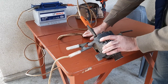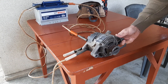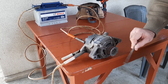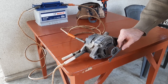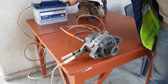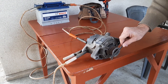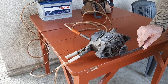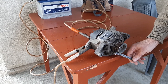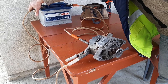I tried to attach a 10 mm wrench to the pulley and you see it sticks to the rotor. Why does it happen? The matter is that alternator diodes are one-way valves which allow current flow only from the alternator to the battery. If a diode fails — even one diode — the battery voltage will flow back into the alternator and make the rotor wire winding work as a giant electromagnet. And if your alternator rotor assembly is constantly working as a giant electromagnet, this will cause parasitic drain of your battery.